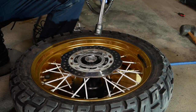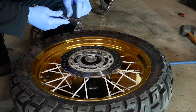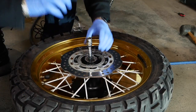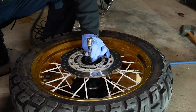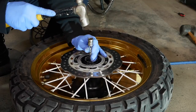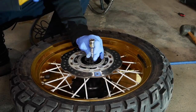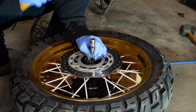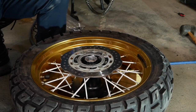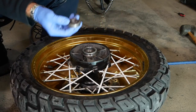I won't use a special bearing puller on this side. Instead, I'll use a 20–25 millimeter socket placed upside down. Line it up so it's bigger than the centerpiece of the bearing, and basically tap it out. You want to contact the edges of the bearing as much as possible. Don't put the socket right in the center — do little bits on each side at a time, and there we go, it just popped off.